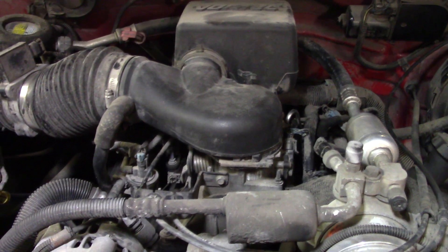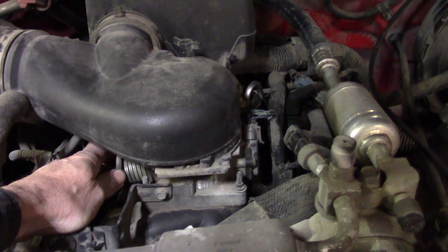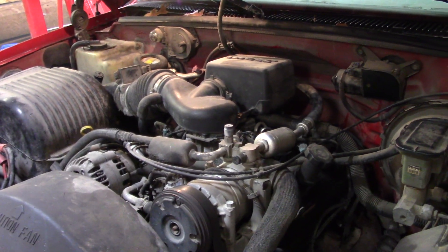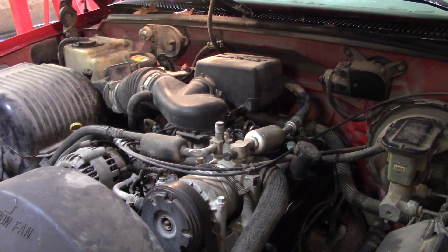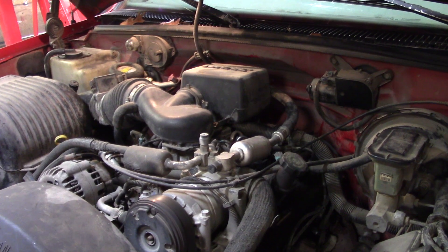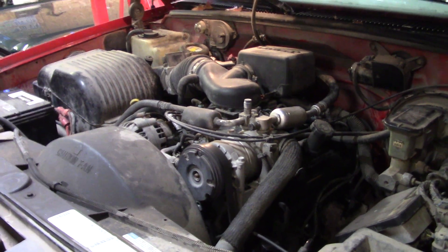I may need to get the carburetor cleaner out here to see if it's got a vacuum leak. She's running a bit fat, but it's cold — it's just the first start. The check engine light's kicking on. It sounds so much better though. We'll run some type of fuel cleaner through it and change a couple other things. It probably needs an air filter — looks like it has quite a bit of dust in it. I'll let it get hot. I don't have an oil filter or any of that stuff yet; I'll have to wait for the stores to open. It's still pretty early in the morning — we'll get a bunch of stuff and get after this.